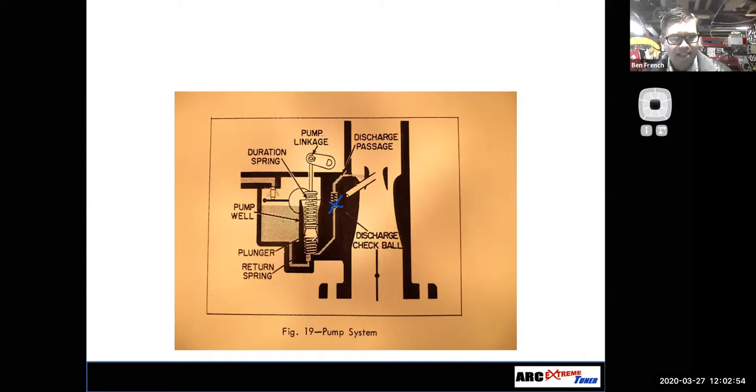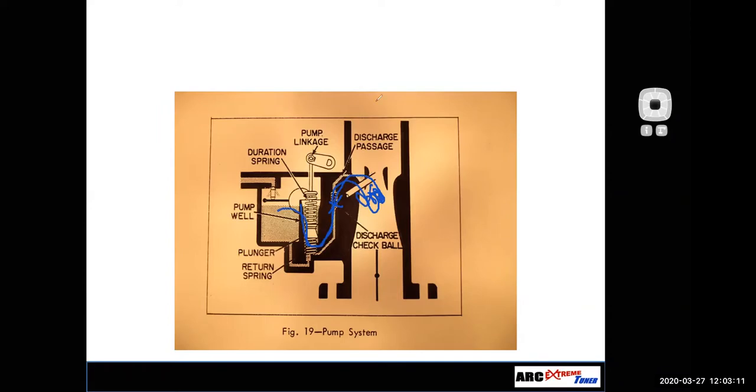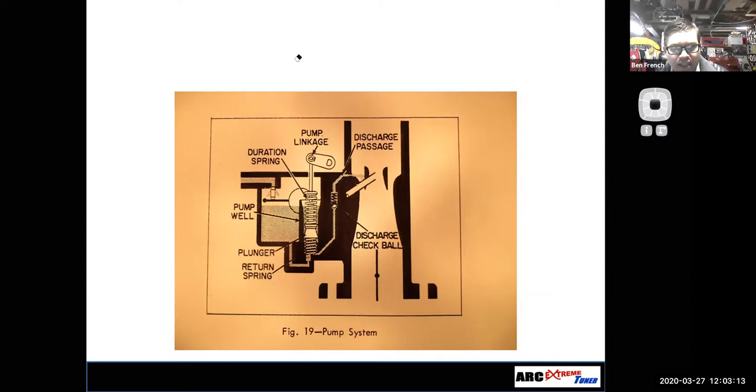It would, because now it would just start sucking fuel, the Venturi system, the main metering system, through the low pressure created through the Venturi, would just suck a bunch of extra fuel through the accelerator pump system. That check ball is there to make sure that it comes off its seat and lets fuel go through from pressure from this side, but it doesn't just let vacuum suck fuel through the accelerator pump circuit. So if you leave it out, your car ends up running way too rich.